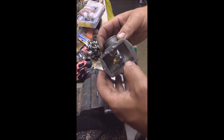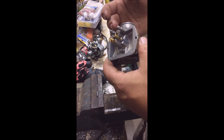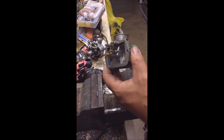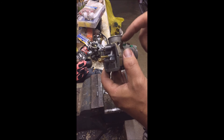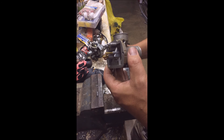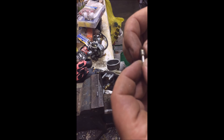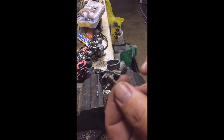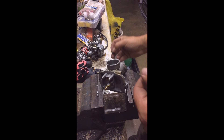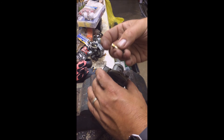So I completely disassembled this carburetor down to everything I could take out of it. I have since replaced these parts as well, since I was back in it again. What I ended up having to do is put some heat on this — which is why I wanted everything taken out of it — I didn't really want a big bonfire in front of me. Once I did that, I was able to easily get this out, and as I was starting to suspect, somebody applied permanent Loctite to this. That's why it was so hard to get out. Thankfully another one came in that rebuild kit — there was a spring in that as well — so that's a new one.